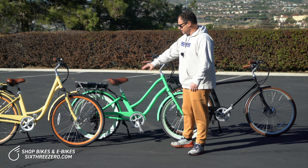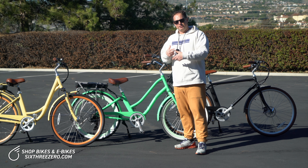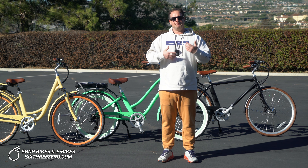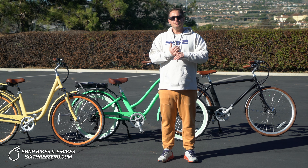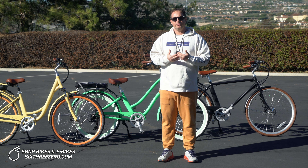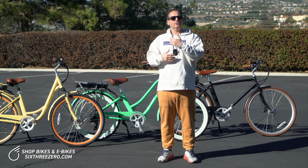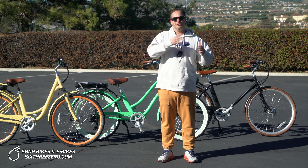The next level up, which is what we use, is seven speeds, and I see this on a lot of electric bikes as well. The chain wheels on the front can vary — the larger the chain ring, the harder it's going to be to pedal in those gears versus one with a smaller chain ring in the front. When you get to seventh gear with a larger chain ring, it's going to be very hard to pedal, but you'll be able to hit higher top speeds. We at 630 believe in seven speeds on e-bikes for a couple of reasons. One, it gives you good gear variance to tackle hills — even when riding up very steep hills on an electric bike using pedal assist, it's still beneficial to have first gear where it's easy to pedal to get you up the hill. You can choose: if the hill's too easy, go into second gear; getting easier, go into third. It gives you the range to find that sweet spot, and it matches your pedal cadence with the motor output so you can find a good rhythm.